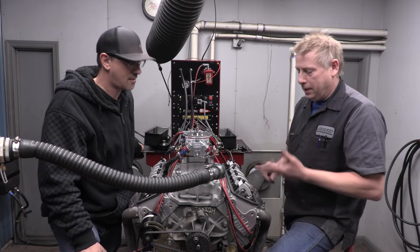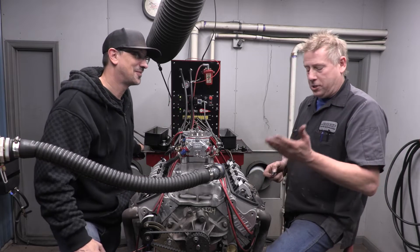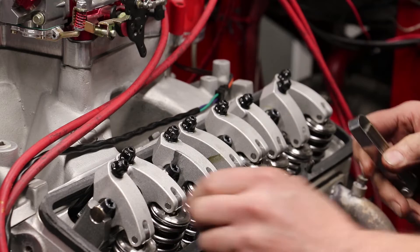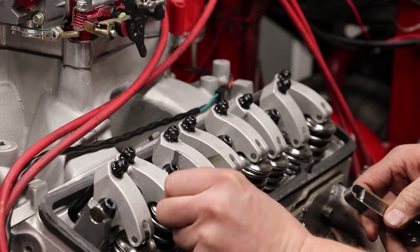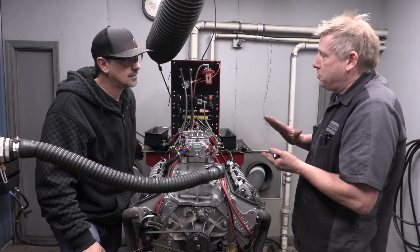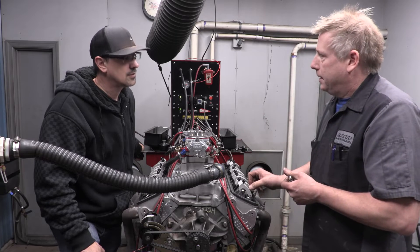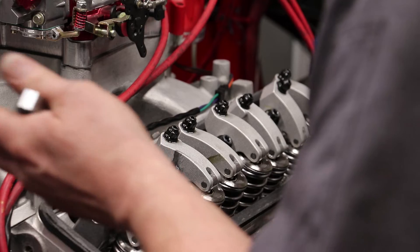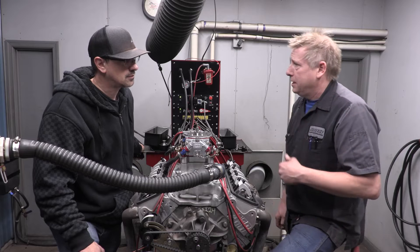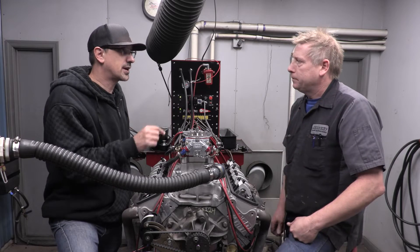The last thing you have to know is what kind of camshaft you have - solid or hydraulic. A solid lifter will have a given lash, while a hydraulic has a given amount of preload. Preload means you take all the slop out of the valve train, then compress the little hydraulic cylinder in the lifter a little ways, and it keeps all the slop out so they're nice and quiet. When all eight of them are ticking you get a lot of noise, so guys like hydraulics for that reason. Solids make more power.